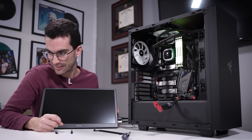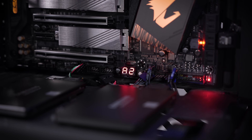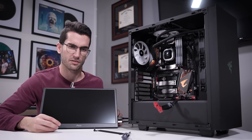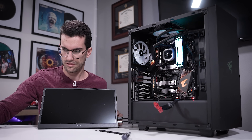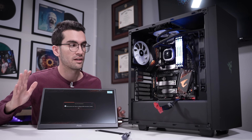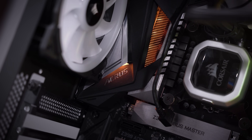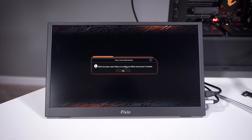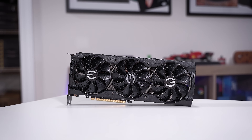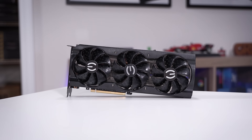That's not a good sign. The system is at least trying to post, which is way better off than before. I think it's training memory now because it's been off a while and hardware changes were made. We're in the BIOS — that was our issue. The CPU has integrated graphics, and with the HDMI cable wired into the motherboard we have picture. That tells me it is more than likely the card, since it was the only thing we changed between runs. To triple-check, I'm going to plug this card into a separate rig and make sure it is in fact the issue.